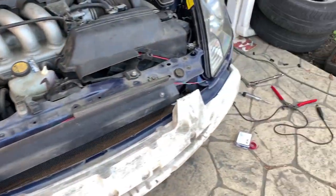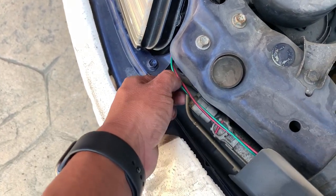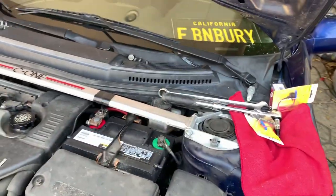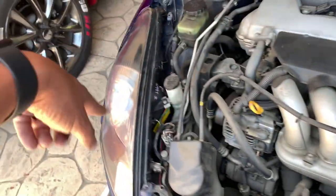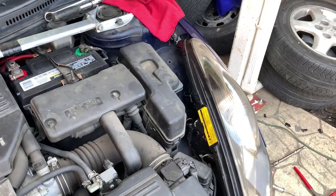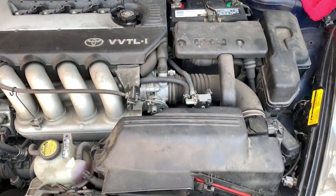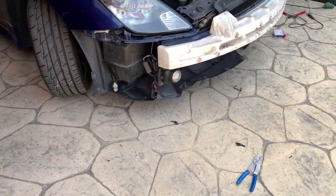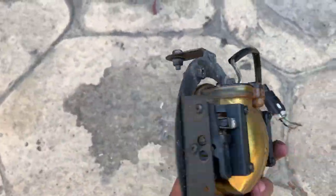The lights are already installed, even the leveler switch. I kept the same colors - this is my signal and power going over there. Only the signal I got from there; I got power from somewhere else and grounded them somewhere behind the headlight so it's not noticeable. I still need to do the switch up front - I'll show you that real quick and then start working on the fog lights and installing these TRD fogs by Toyota OEM.